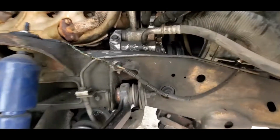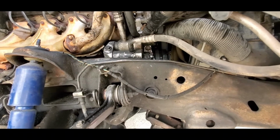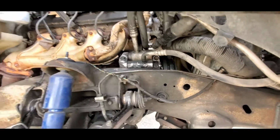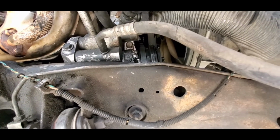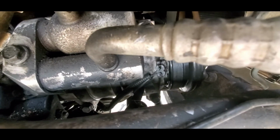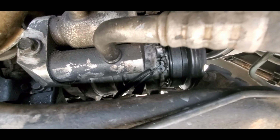And you'll also need some extensions and swivel heads. And one thing also, the last thing is, do not forget to get a ratcheting wrench. And it's going to be 15 mil. That will save you a lot of heartache and pain, because that one bolt down there, it's 1/4 of a turn at a time if you can get that. It takes a little while to get that one out.